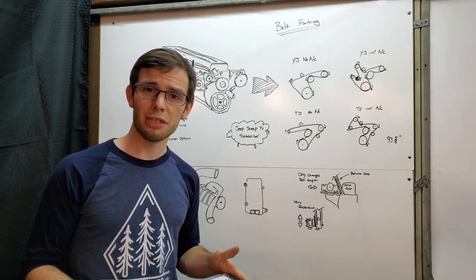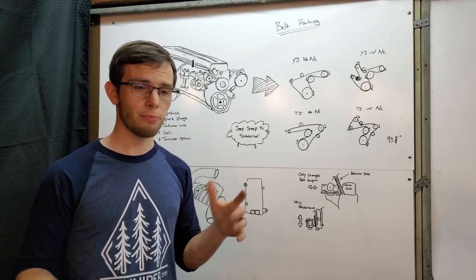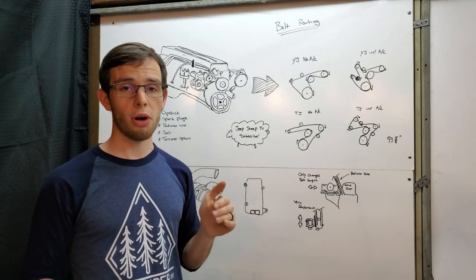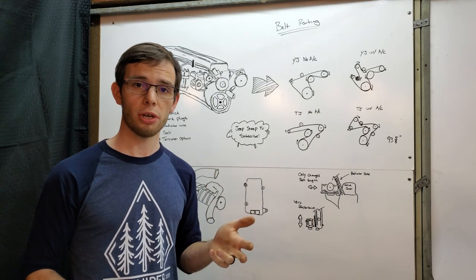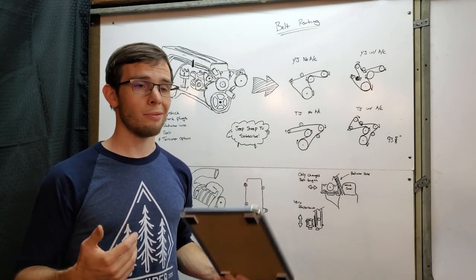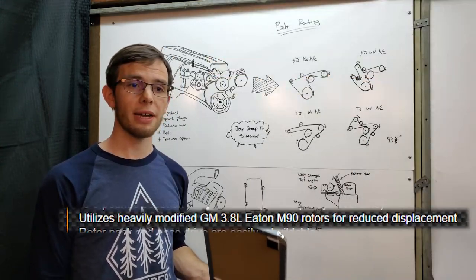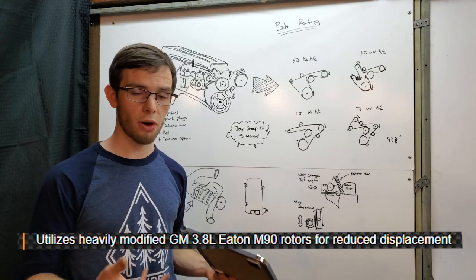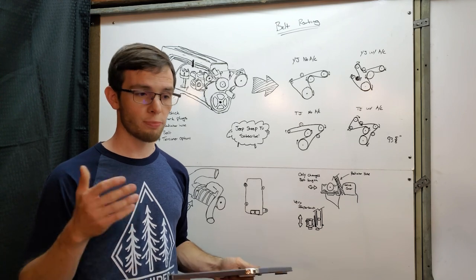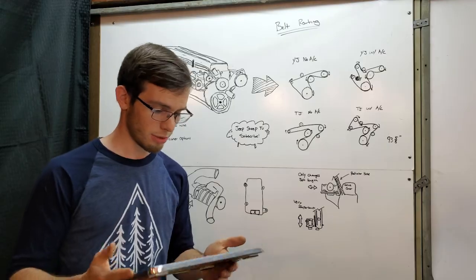This one's interesting: it's supposed to be dry. The rotors have a coating on them, and that coating is important for it to maintain its function. Meaning you shouldn't be spraying gasoline on the Eaton superchargers because it can eat away the coating. We talked about the Boosted Technology supercharger before, which is a heavily modified Eaton. The guts are Eaton, so I'm curious how they managed spraying gasoline into it when you're not supposed to be doing that.